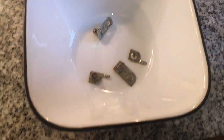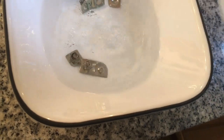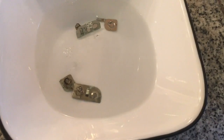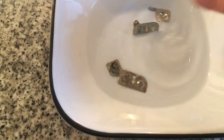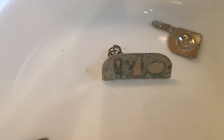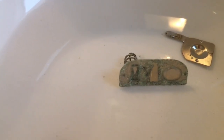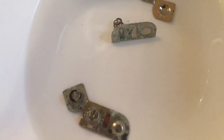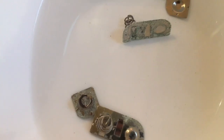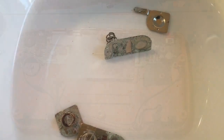Got the parts in a bowl and just gonna soak them completely with white vinegar. I might let it sit for a couple of hours — we want it to really chew away at this rust. You can actually see it's starting to bubble from the rusty bit, which is a good sign — the vinegar is reacting with the rust. Vinegar will help neutralize the process of rusting, so it'll stop the rust from getting worse even if it won't make it go away entirely.